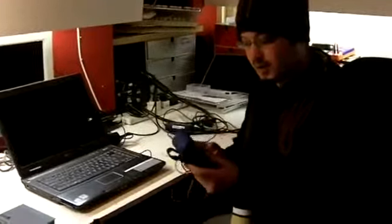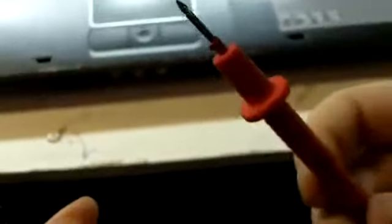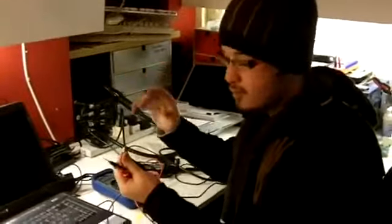If you come closer, I'll show you where to set it. I would set my voltmeter to 20 volts. On voltmeters you have obviously the red one for the positive and the black one for the negative, okay? So you're going to hook these two up, and I will get the tip of the charger. But make sure, obviously, this is going to be electric, so I have to declare some warning: protect yourself.